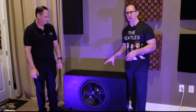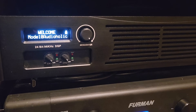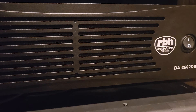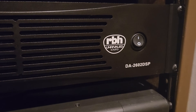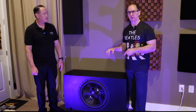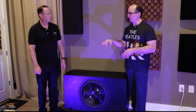There are two configuration options: the amplifier can be inboard in the subwoofer, or you can use external amplification — which is the route we went here. The external amplification gives you four kilowatts of power at 110–120V, and actually around 4.5 kilowatts at 220V, so you'll get a little more power there. Bottom line: if you're putting in a sub like this, get a dedicated outlet — don't use a shared outlet. This amplifier is powerful, and I'll share bench test results in the review.